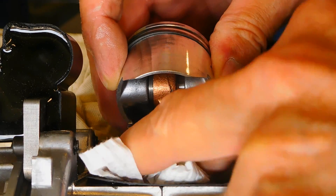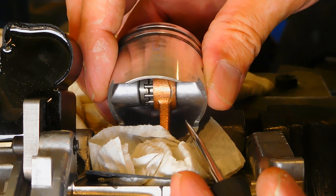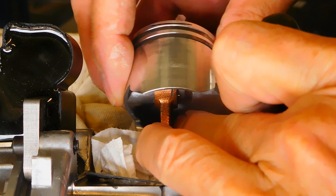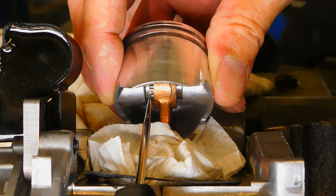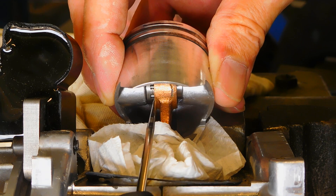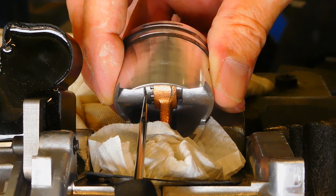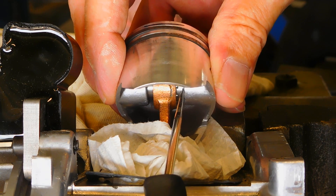Now, regarding what I spoke about before — the small end bearing, you can see it just hangs out each side of the conrod. The piston is held about centre of the rod when the cylinder's on, but even so the bearing can hang out. That means the roller isn't full width — the roller's sort of on one side, so the stress on that rod is off centre. That could be a problem for the rod, and it can float from one side to the other. It's just generally pretty shonky, and could have been easily resolved by the manufacturers by just putting a little aluminium washer each side of the bearing.